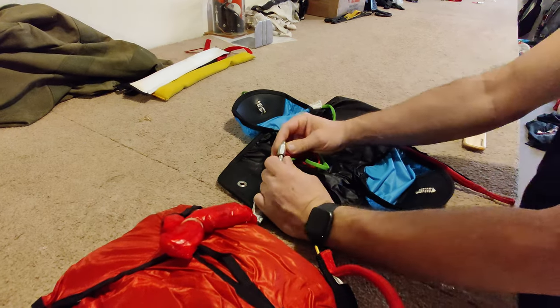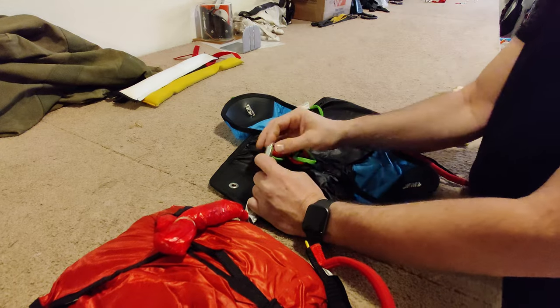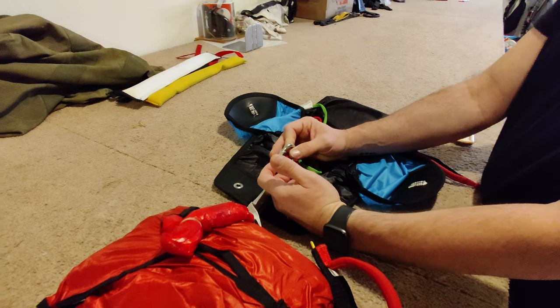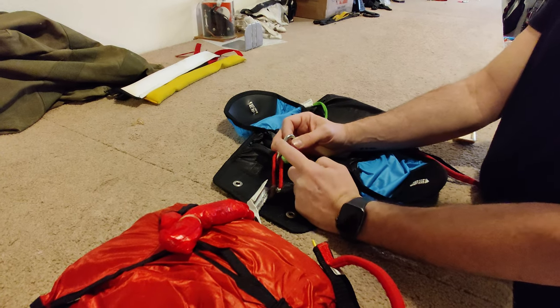And these should be torqued down. Another thing I like to do with these French links: after I torque them, because there's a very specific way of doing it, I'll take either fingernail polish or a marker right up here. So then every time I open it up and look at it, I can see if that's moved and loosened up on you. Cool.